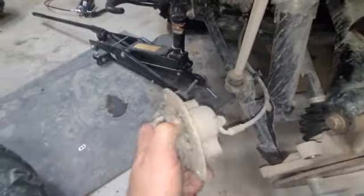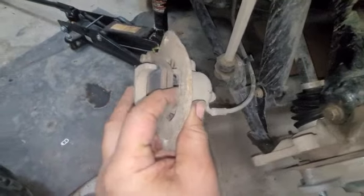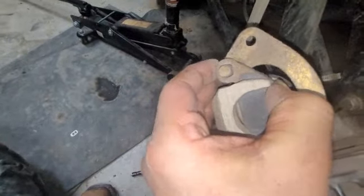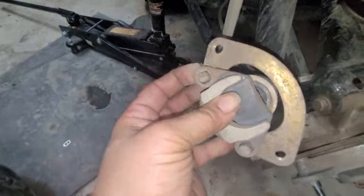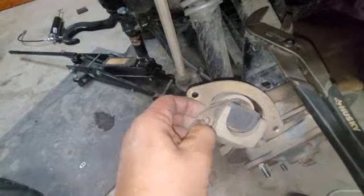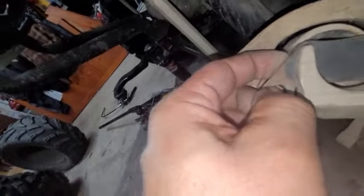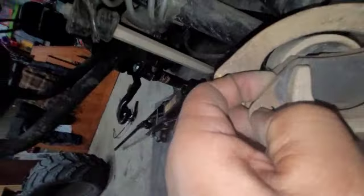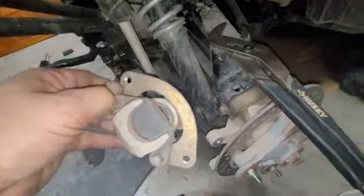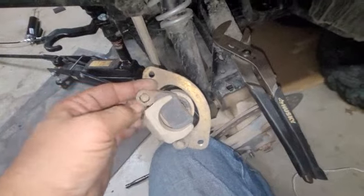you go ahead now, you get your set of adjustable pliers here, and push that piston back, which is right here. That piston, you're going to have to push it back a little bit. It's not going to take much, and then you can get this brake pad here off. Unfortunately, I'm going to need two hands to do this, so I'm going to try my best here. Helps when you get the other side up as well. Okay. All right, I'll be right back because I'm going to need two hands for this.